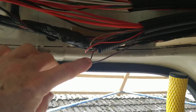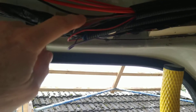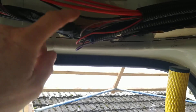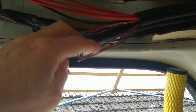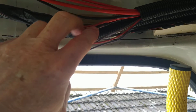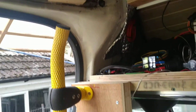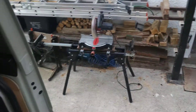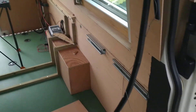Here's the original wiring — here are two purple wires, this is the red supply, and this is the switched live. All I'm doing is taking it through the relay and connecting it up to the original red and brown wires. That allows me to basically have the three interior lights working on the sliding door or the rear door in auto mode.